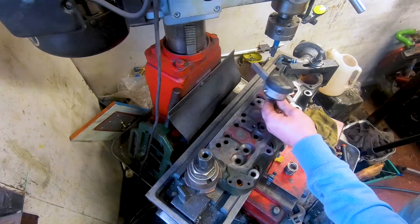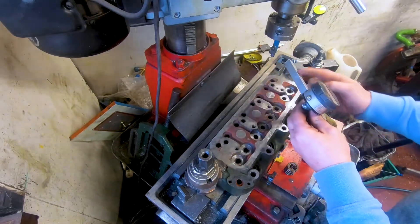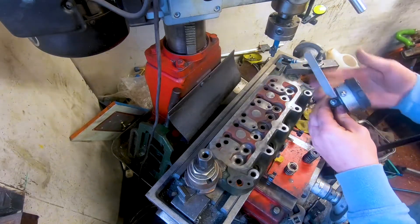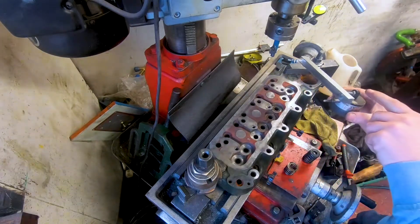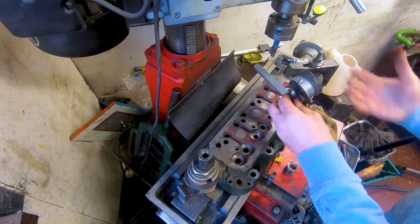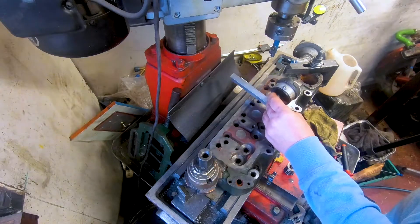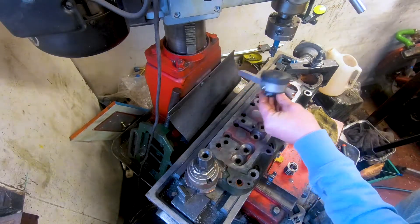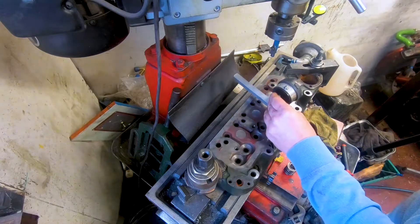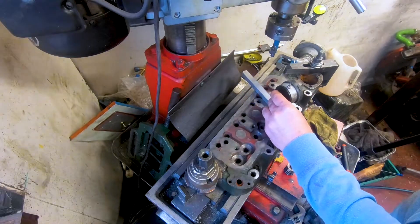I'm going to demonstrate a couple of these valve spring seats with this dial indicator tester that I made. It's a very simple apparatus — just a digital dial indicator set across an aluminium straight edge which I've stoned flat, mounted with a bit of threaded rod. It's a very simple apparatus but gives very repeatable, accurate measurements of this particular dimension. No big expense, but accurate repeatability. I have this set to what should be the standard for a Mini, tested off camera.